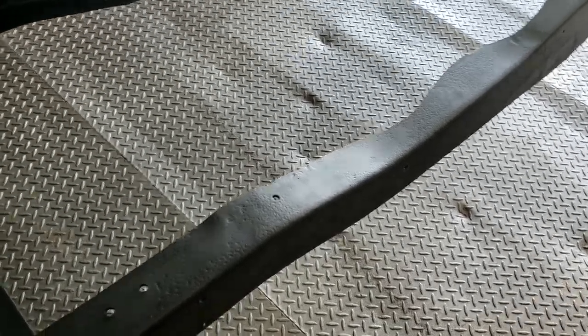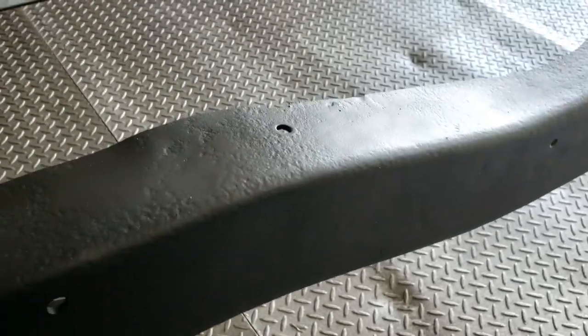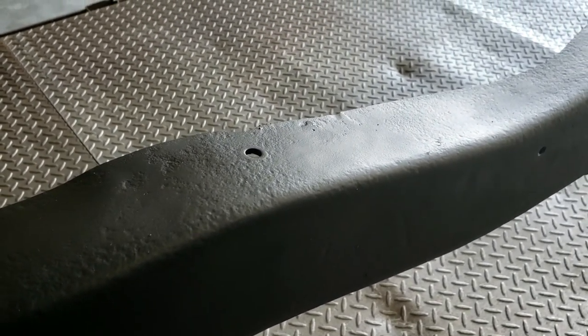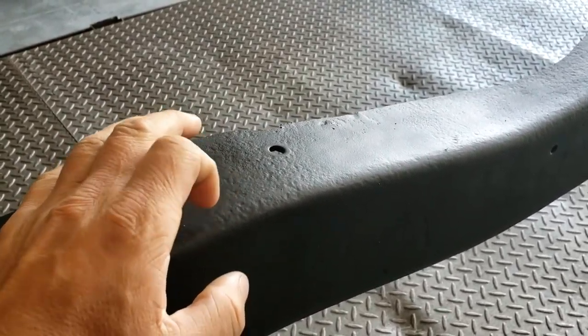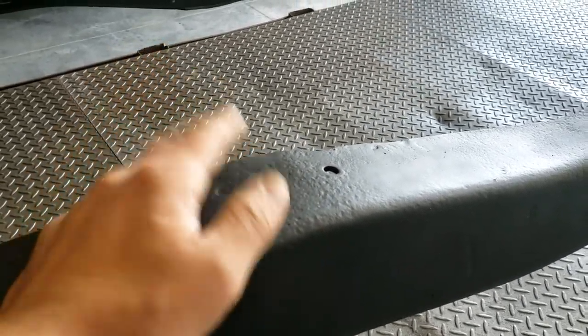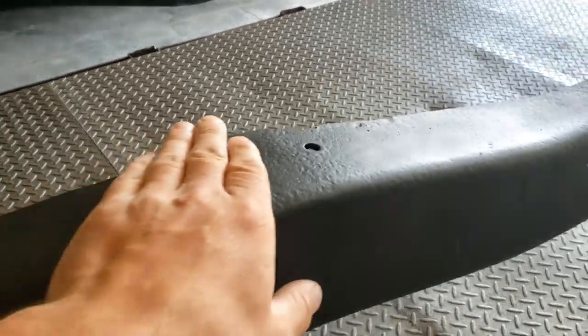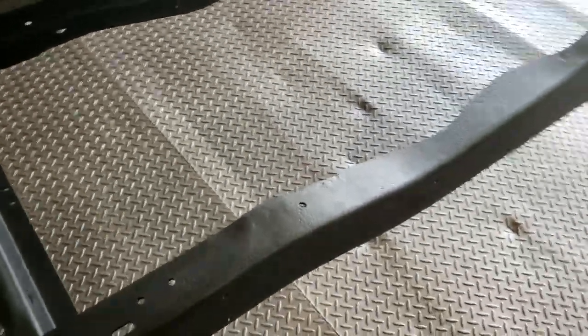One more major discrepancy worth noting is the film thickness that they recommend for the paint and what they claim their paint can do. So for these rust pits, the silver paint with the aluminum filler in it is supposed to fill these in. Well, those are pretty deep. So if we're only putting 2 mils paint on here, it's not gonna fill those in, that's obvious. So they are basically advertising it like they want you to just pour that stuff on nice and thick and let it fill in like a high build primer. Well, they say very specifically, only apply 2 very thin coats.